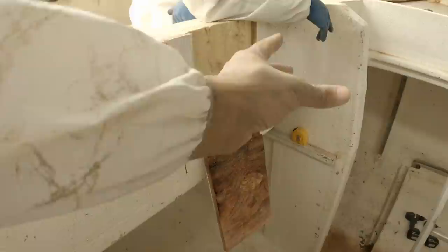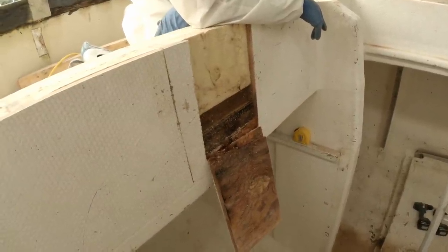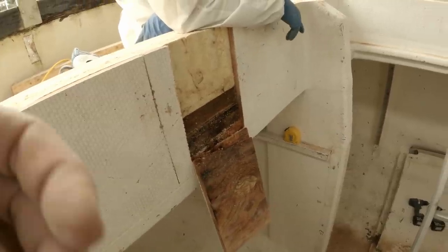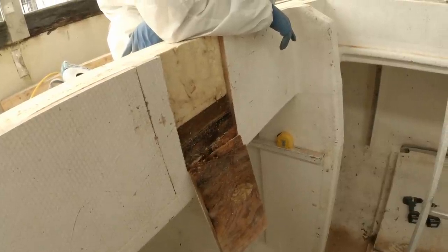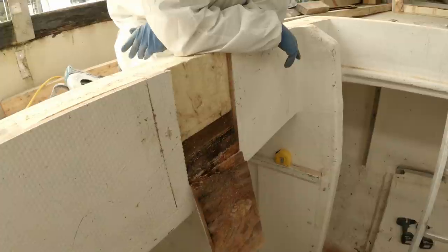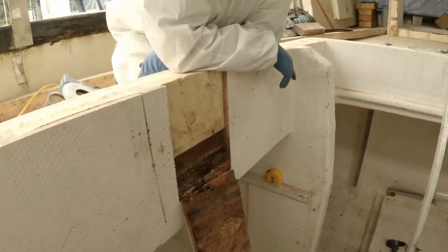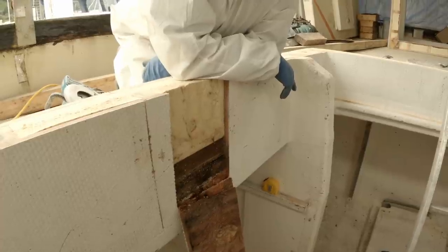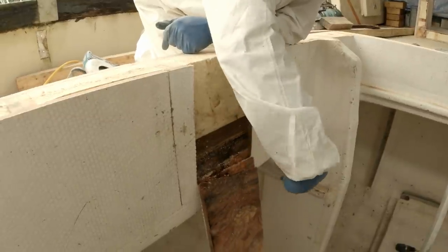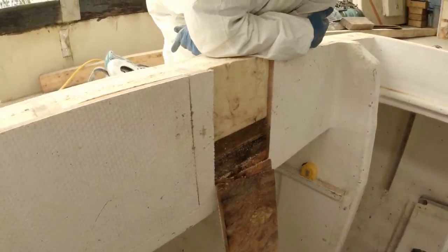And then we're coming right here, we just put another beam, right? And connect them somehow. Yeah. I think the same thing we did back there, really. We put in a main beam, and then we should really just be able to come in here with a couple of short pieces of 2x4. Yeah, for the in-betweens. Just toenail them in or whatever. Or notch them. Because here we can run long legs into them from that side. Oh, yeah. And then the other side. True.